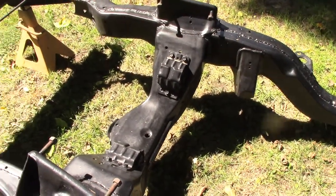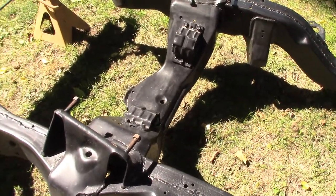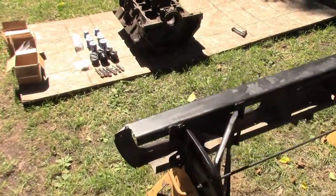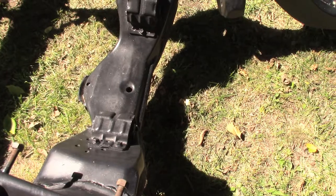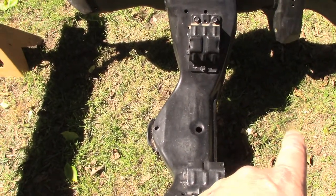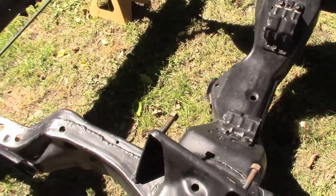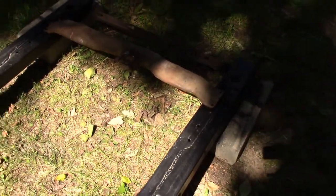We're going to mock the motor up in there. Small block, big block, doesn't matter — it's all the same block, different height, different bore and stroke. The 403 mounts bolted right on there, and that's what I chose, because that keeps the motor slightly back on this cradle so the weight's not in the front. It keeps the weight back a little more. We're going to mock that up with the transmission. I've got that set up with the slots for the 400, mocked up to fit in the frame — the holes moved back four inches, which is usually the standard for that. But we're still going to mock it up. If you don't make these kind of changes, then you don't need to mock it up.